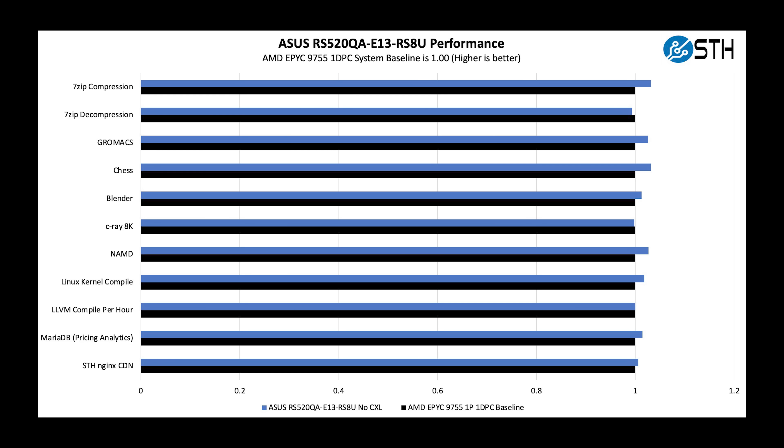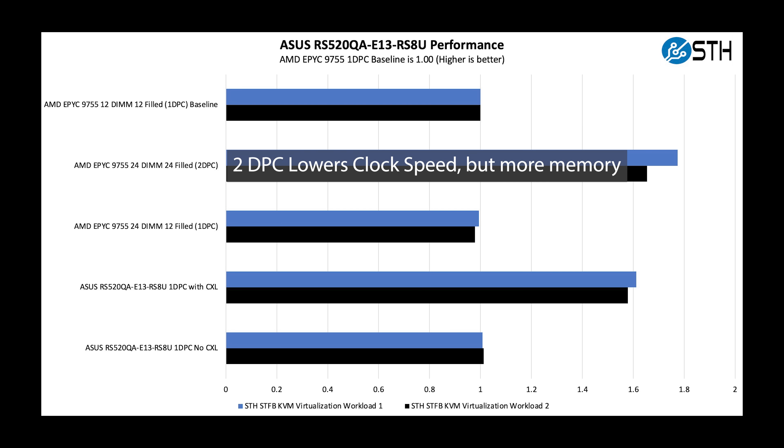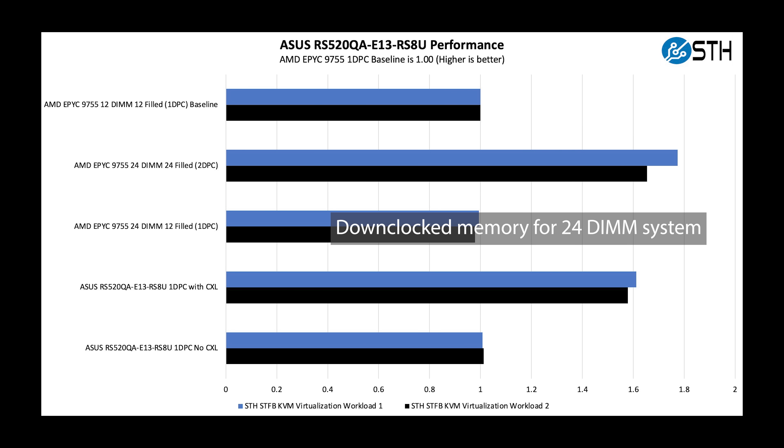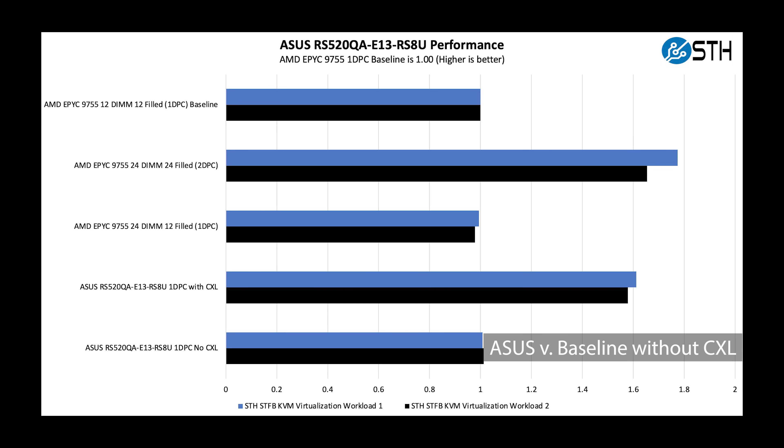You're probably wondering what the impact is of adding this extra CXL memory. We loaded up a virtualization benchmark using KVM. The idea is there's an SLA on each workload, and we're trying to see when a CPU and system can no longer support more VMs at a given SLA. We ran the workload both with and without CXL memory. We are able to run more virtual machines when using CXL memory — that's really the whole point: additional memory with a little more bandwidth, giving you the ability to use those processor cores more efficiently. CXL is a huge topic with a lot more complexity, but this gives you a simple mental model of what's going on and why you'd want to use it over straight PCIe.